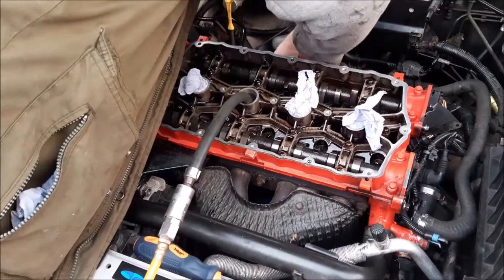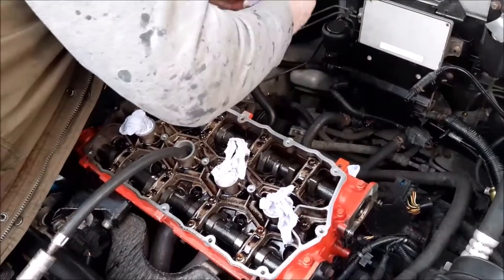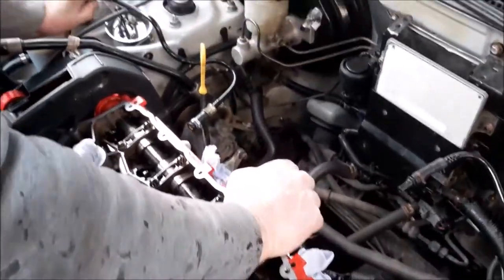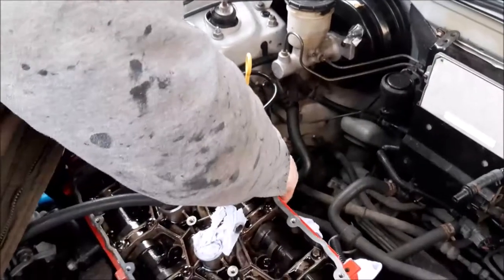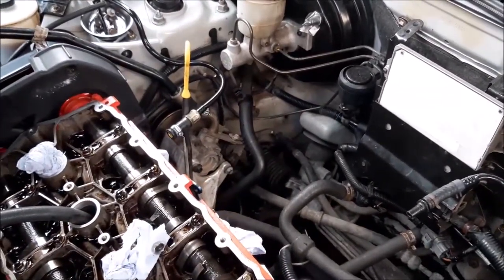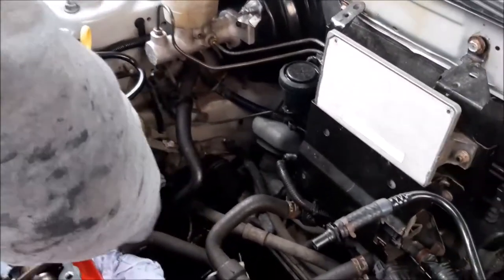So it's connected and the air is going in. Remember, a low pressure, only around about 2 bar, and we're now just going to look around and check to see if we can see anything coming out. Right, so we're going to now check the inlet manifold and check we can't feel any air. You can hear a little bit because obviously the airline leaks a little bit, but what we're looking for is air coming out in places that it shouldn't do. Nothing coming out.